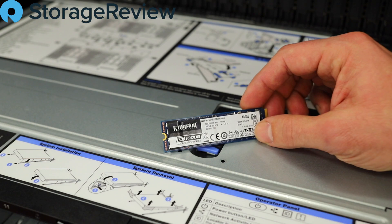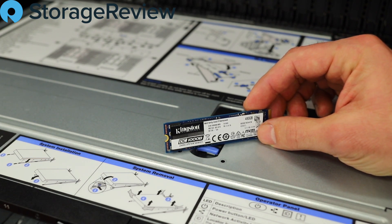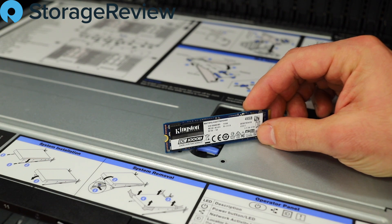As we take a closer look at the drive, it's an M.2 form factor, 2280 — that means 22 millimeters wide and 80 millimeters long. The M.2 is important because now we can put this on the board. Most modern server boards have an M.2 slot, or we could put it into a PCI adapter and use one of the expansion card slots in the back.